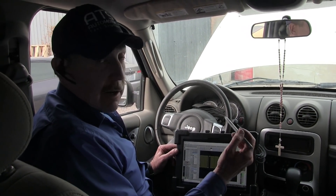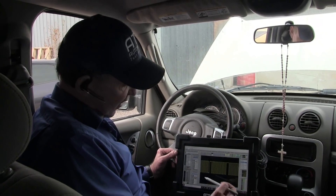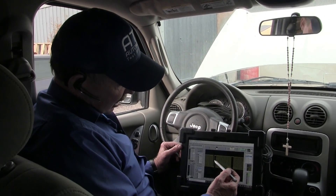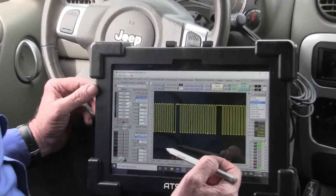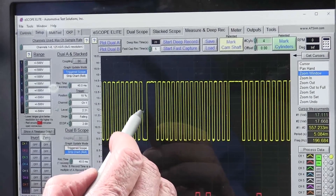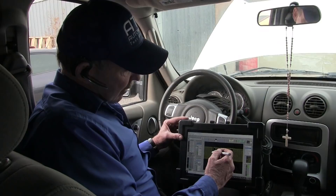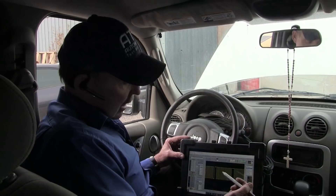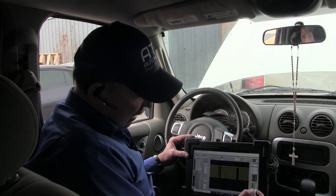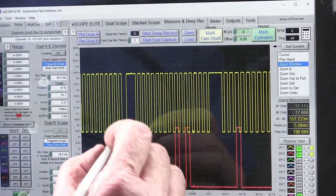What we're going to need to do is go get in the power and ground that go to this crank sensor and make sure we don't have a problem — that the power and ground continue to feed power to it. Because if it doesn't have a good power and a good ground, it cannot work. But it's really interesting the way the sensor is just latent. It pulled down, it just let go too late. You can see how when this one pulled down it let go really quickly — this one is late. The cam sensor is fine as we can see. It's not breaking down. This is a crank problem.